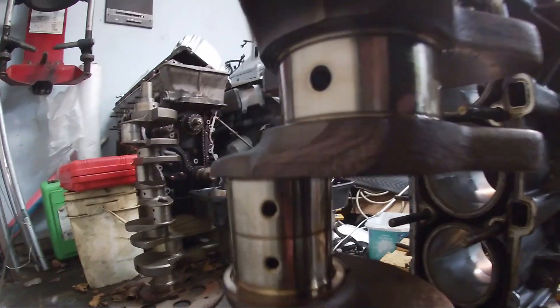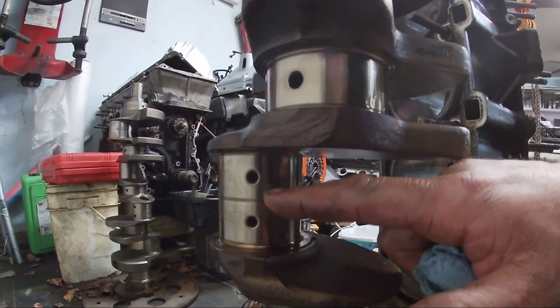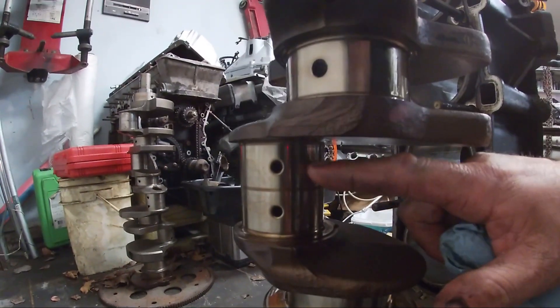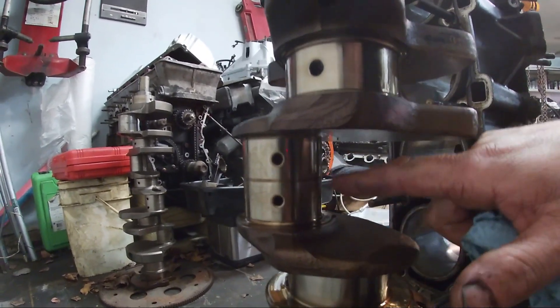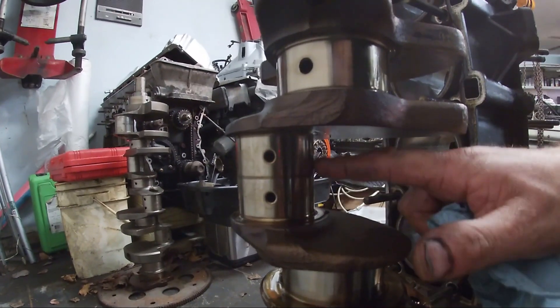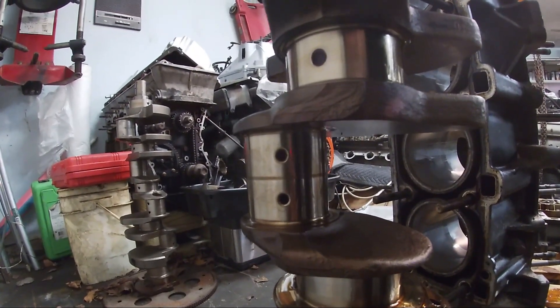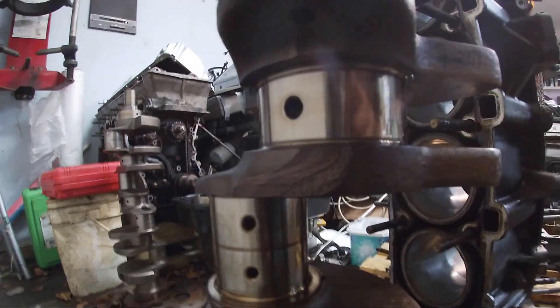This is the infamous two-six oil gallery and there is a line here that's a little darker than all the others, but I don't know if that means anything. What I am happy to see is this oil gallery is offset towards the outside — that would actually center the oil gallery when offset ground, which may improve the situation.